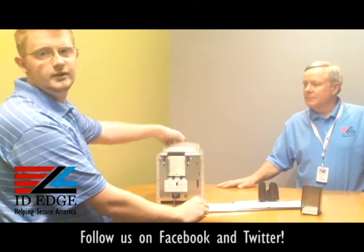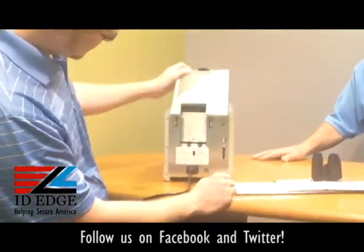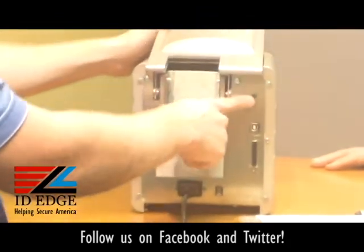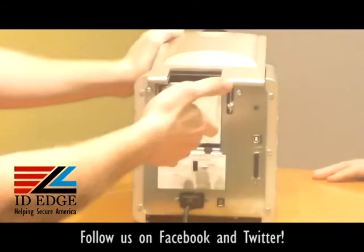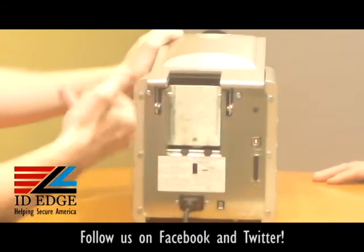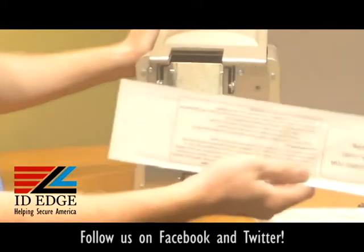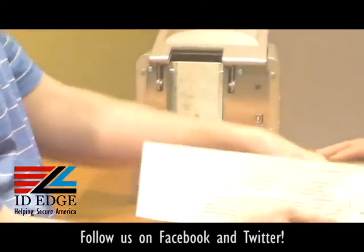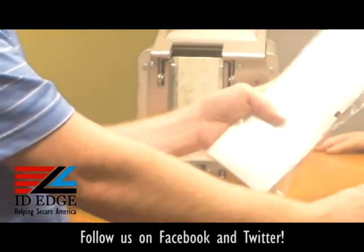In order to clean this you need to have the lid open. The button we're looking for actually gets covered — it's this little button right here. When you push it, it starts requesting cards. On the front of the screen it's saying it's time to clean. We're going to go ahead and insert our cleaning card, which comes from our kit 36330053.